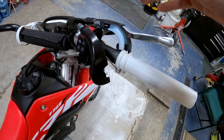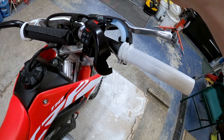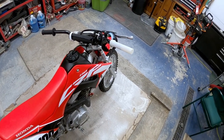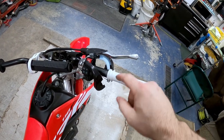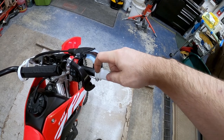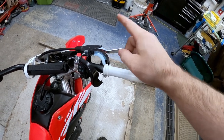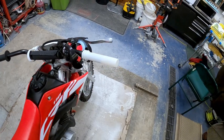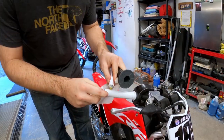So from here now, I'm gonna go ahead and get this tightened back up, adjust the play, and then we'll swap the grips out. A lot easier, feeling a lot better, so that's just it. In the description below, I'll put the link for just the Motion Pro before it's modified. Grind out a groove, loosen up your cables almost all the way to let it in, and then hey, you got a full-size throttle tube.